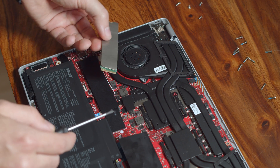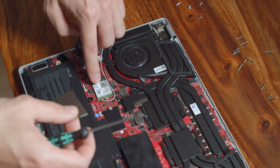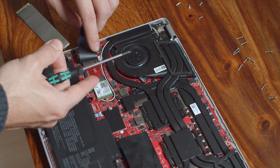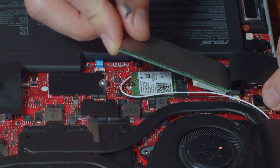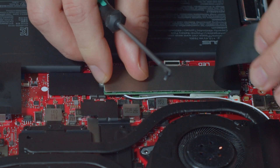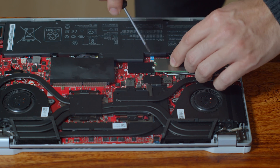A rather cheap and fast model that goes well with the ROG Zephyrus is the Crucial P1. Unfortunately, Ryzen 4000 in laptops doesn't support PCIe 4.0 so far. Underneath the SSD you can see the WiFi module of the ROG Zephyrus — that's nice to know if you ever wish to replace it at a later date.